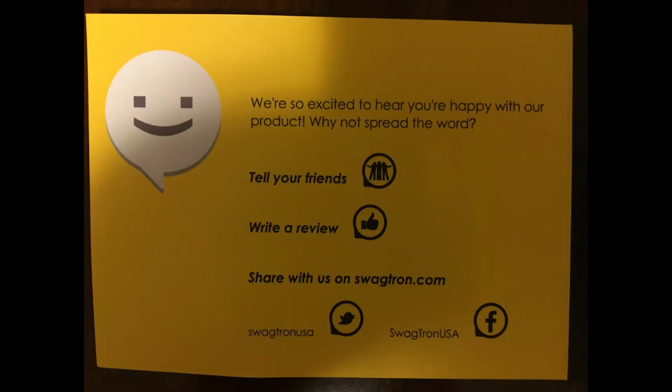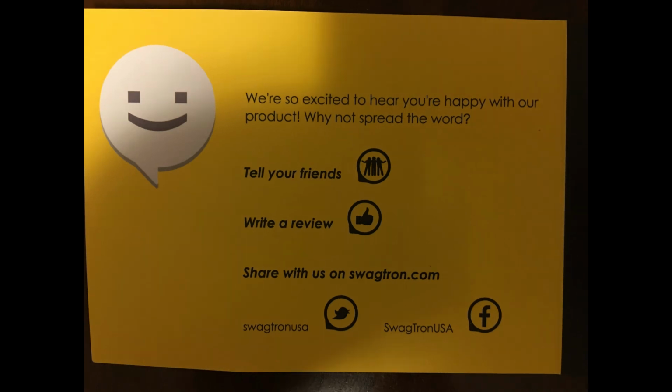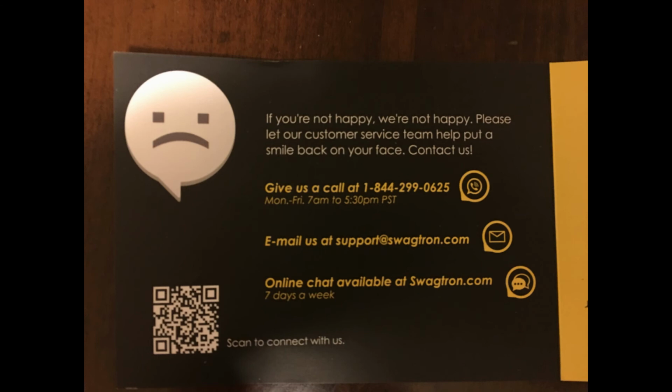Ensure the e-bike is turned off before charging and remains off while charging. Connect the charging adapter and cable together, then remove the rubber stopper covering the charging port. Insert one end of the charging cable into the charging port and connect the other end to a wall outlet. Allow at least 5 hours when charging for the first time. After this initial charge, average charging time is 4 to 5 hours.